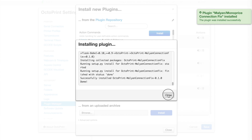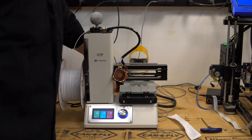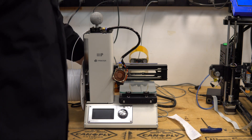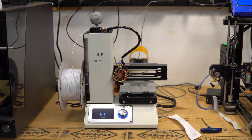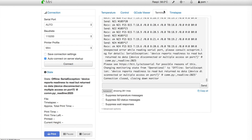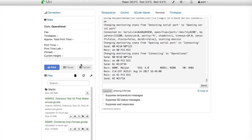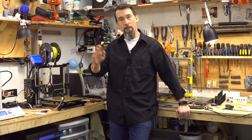Let's look at the results. When connecting, first turn off and on the printer. You have to reload the OctoPrint webpage to see the current connection status, then try to connect. Just click Connect once this time — and now it works on the first try. One frustration less from now on.